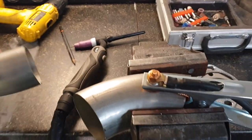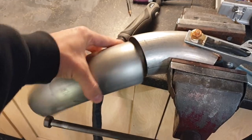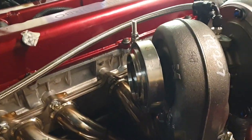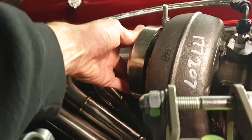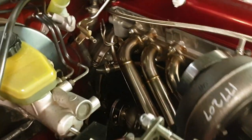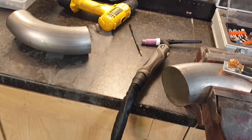I've just offered up the downpipe and it appears I've got to make a shape that looks something like this funky shape, and I'm going to tack it up with the TIG welder - it's an R-Tech by the way. The Marmon flange arrived today, strange old looking thing - it's basically a tapered fit V-band. I think I've got it fairly central; apparently they're quite hard to center but mine feels very much like it's found center. I've put the exhaust in position and I can just see the flexi pipe section. I'm going to start getting that ready to try and build up a downpipe - it's probably going to look shocking but at least I will have done it.